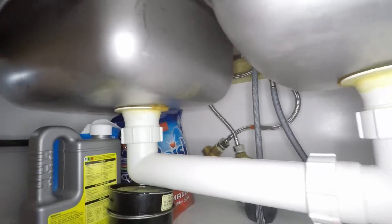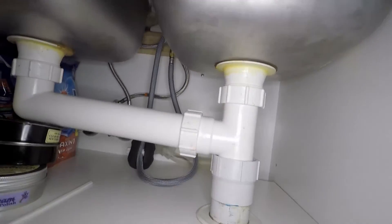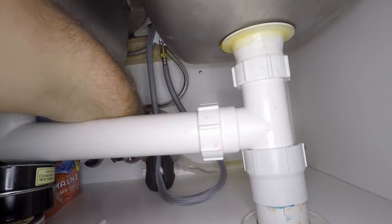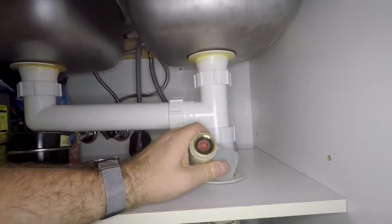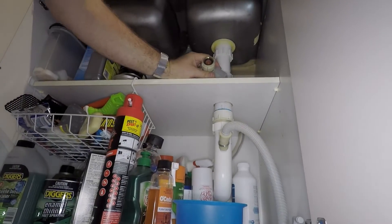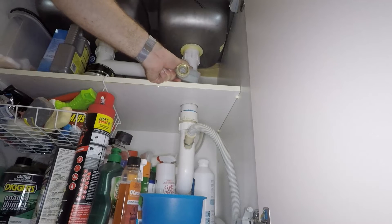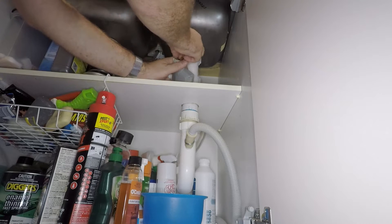This is the water outlet or drain pipe. Everything looks clear there — just remember to fasten that clip back up, otherwise you might make quite a mess. The other thing to check would be the inlet pipe. Keep in mind water will definitely come out of this one. There's a filter in the end of the inlet pipe which does also come out, so double check that it's all clear. There is also another filter in there which does not come out, so don't try to pull it out.